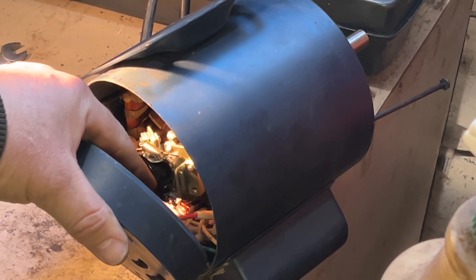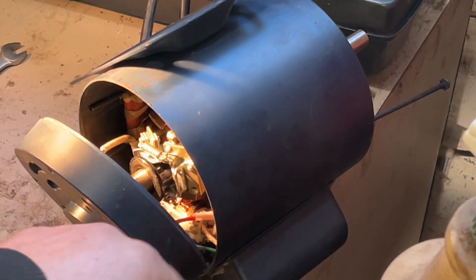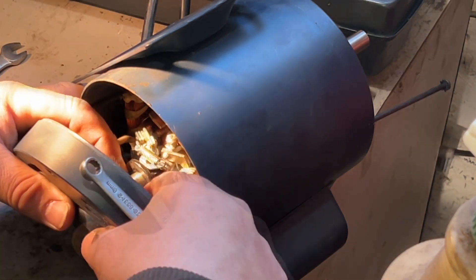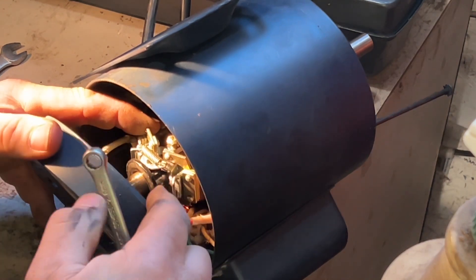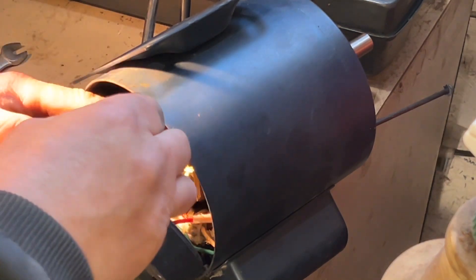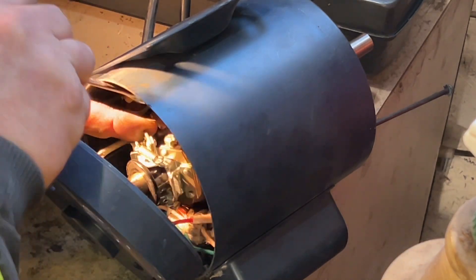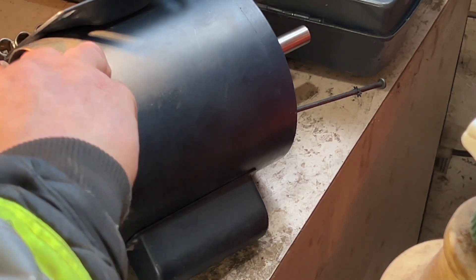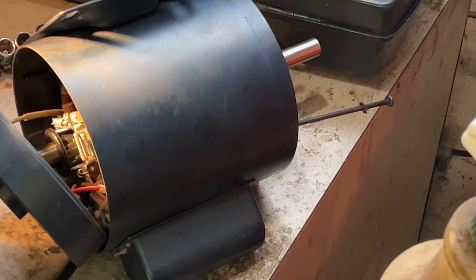Let's see if you can see what's going on. As soon as it starts going, that pulls that round plastic sleeve back and then there's a switch inside that makes contact for straight power. I'm going to go as high as it'll go and tighten this sucker up good this time. I don't know why it came loose on me last time. The capacitor just gives it that extra boost to start, so we're just going to tighten that up and hopefully it's in the right spot.